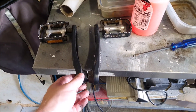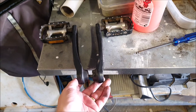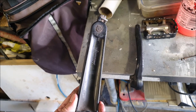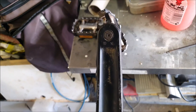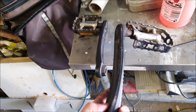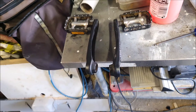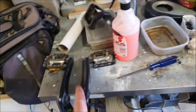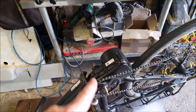Next stage is to put the pedal shaft things back onto the crank, and they are different — this one's got more of a bend in it than that one. They are marked up: this one is marked 'right' and you can see there's a right stamp on the bottom of the pedal as well, whereas this one just has a left stamp on the pedal but no markings on the shaft — whatever the word for that is. I also have to remember that the one on the chain side has to have that chain guard put on first, otherwise I'd have to try and separate the pedal. Also I have to remember that the bike is upside down, so what was left normally would be right and what's right normally would be left.